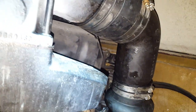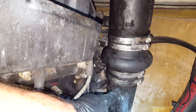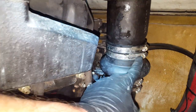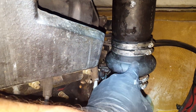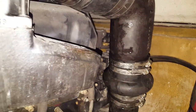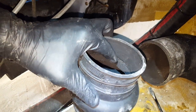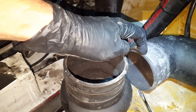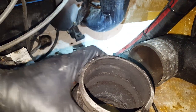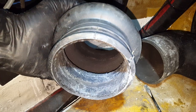Got them all tightened up. Now, it's highly likely when you start this thing up for the first time you're going to see leaks coming out of here. If you do, don't panic — just go under there and re-tighten these worm clamps and see if the leak stops. If it doesn't stop, you may need to readjust this a little bit — perhaps it needs to come down or up a little bit. This has little stops in it, but with original pieces you're likely going to pass right through that, so it can be tough to gauge.